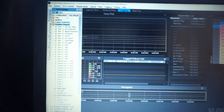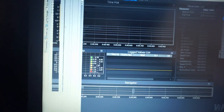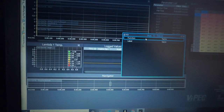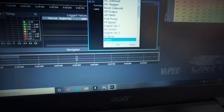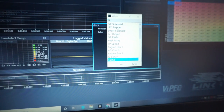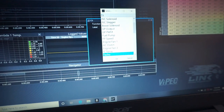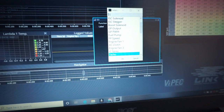So now we are in Gabe's car — laptop here, laptop there. I'm going to give him numbers and show you my numbers too. First, we're going to go into auxiliary 5 to hook up your tach. So go to auxiliary 5, double-click auxiliary 5, then on the function, double-click on the function and look for tach. It should be under the IC sprayer — you found it? Yep. Control-save, or save that setting. It's all saved. Good.